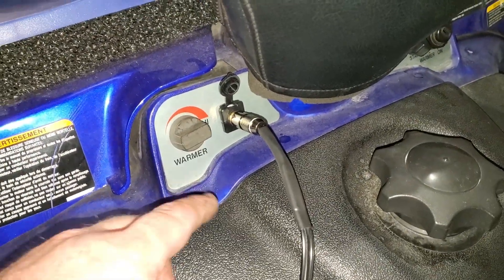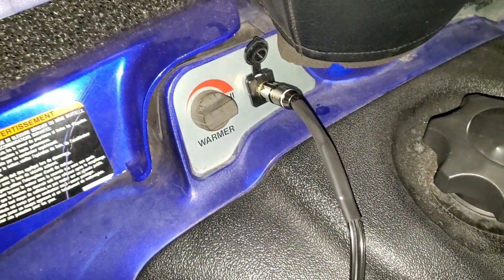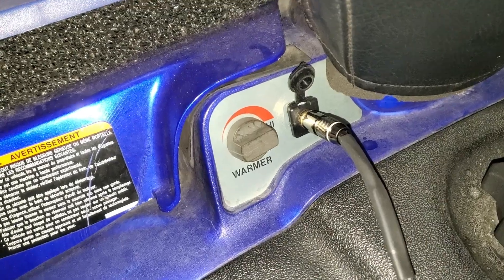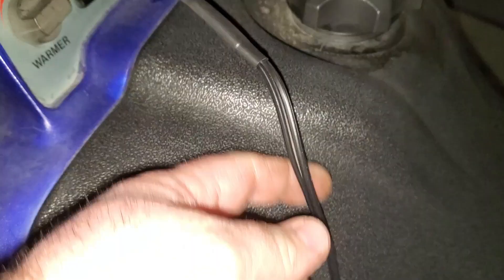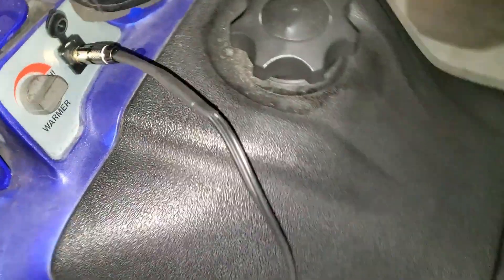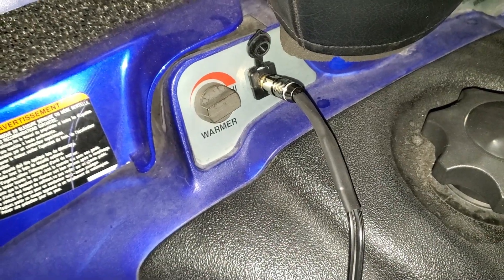On the Mountain Max I built this little attachment that hooks onto the battery tender cable, goes up here and ties into the port where the heated face shield plugs in. I'll put a link in the description to buy the little RCA adapter. I also bought a little battery tender replacement end, cut the existing end off, and put this adapter on there — I'll link that in the description so you can use it to charge during the summer.